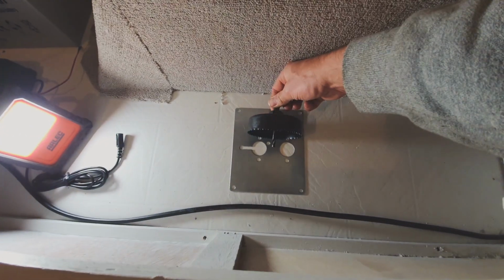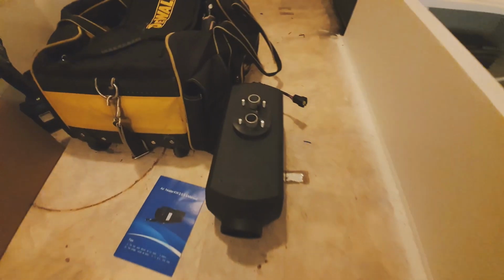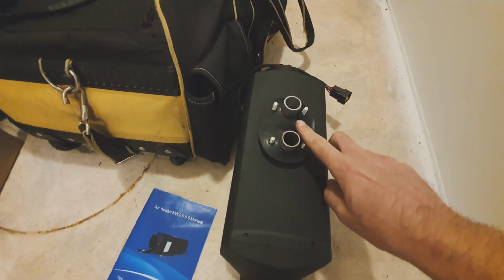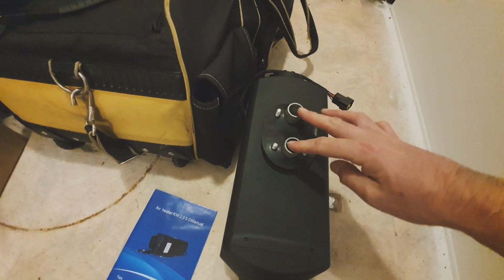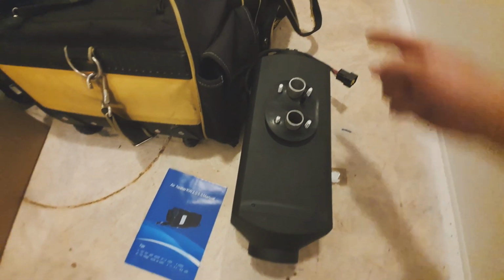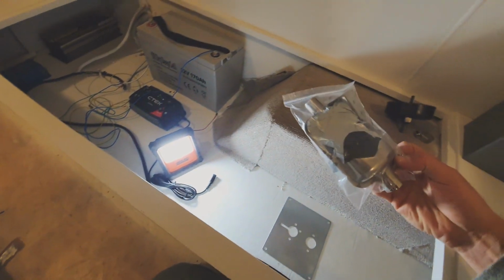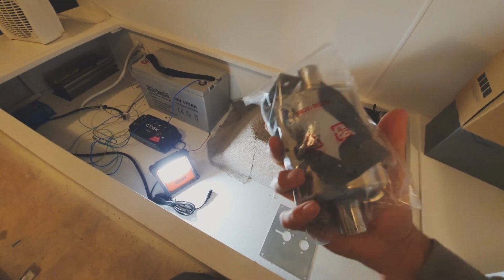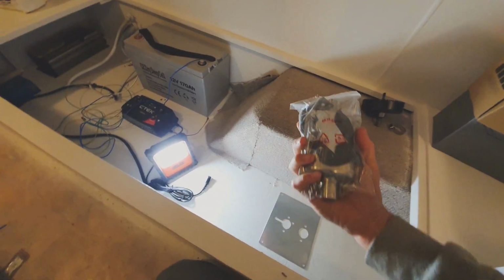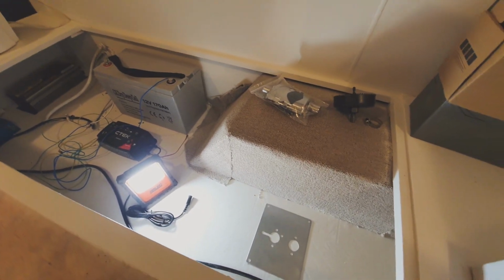And then you're good to go with the mounting of that. The plate gets screwed down. There's a rubber gasket on the bottom here. Fuel line pokes out here. They're the two inlet and outlet for the exhaust loop. The other loop is obviously the clean air in at the back and hot air in the front, but that's within the cabinet itself. So you get a little rinky-dink muffler, and it does actually do something. They're pretty loud, so that takes a bit of the edge off them.